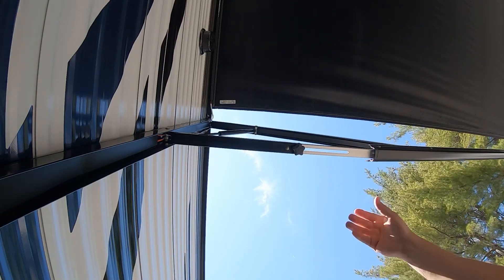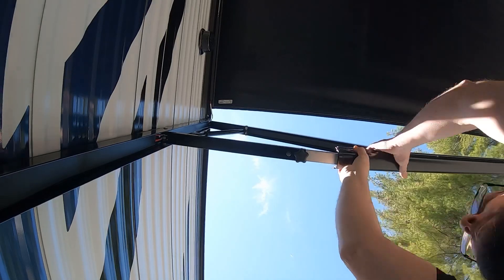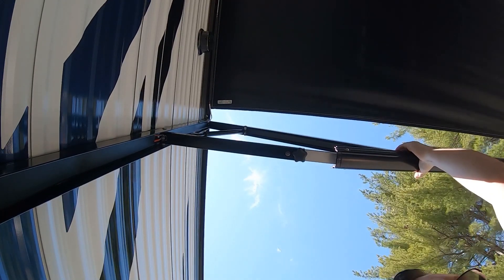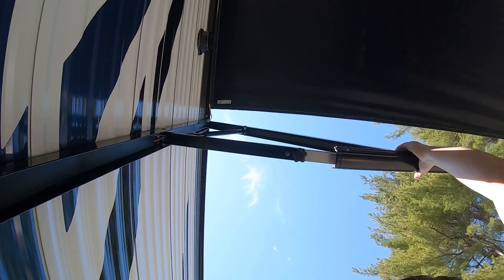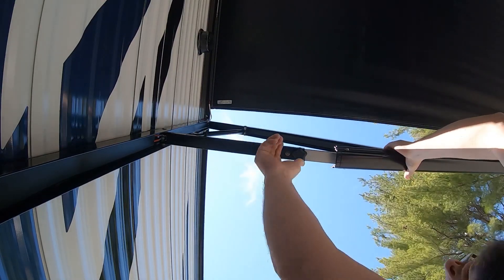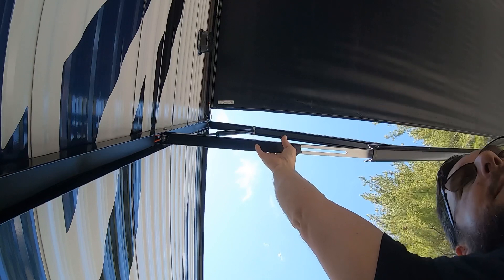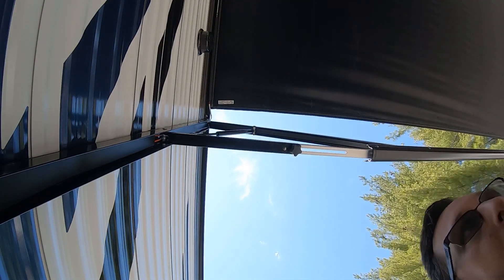When you want to make a rain dump with the awning, pull the awning arm down, lock it into place, and that'll let rain run off to one side or the other. It's a little windy today, which brings up a good point — don't leave your awning out on a really windy day, it will rip the awning right off the camper. When bringing it back in, loosen it up and a gas shock will pull it up quickly. When you've got it pitched down for rain runoff, watch the door — it will start to rub on the awning when you open and close it.